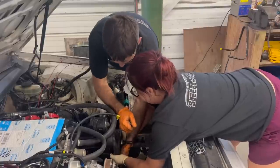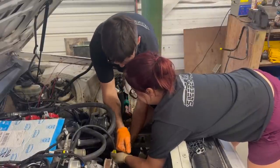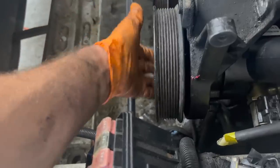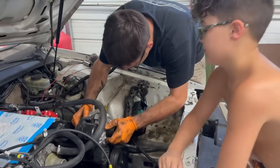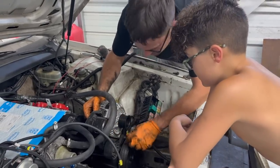We're having trouble with the pulley moving on us. We finally got that on. Here's the real test. Oh, it was the pulley. Okay, we're gonna have to be looking for a pulley, and we probably bought a pump for nothing, as I don't remember this one whining before. So I'm gonna have to get a Super Coupe specific power steering pump pulley somewhere. They thought at the parts store that I was getting this for a diesel truck or something, because it was 8 rib. I'm like, no, just got a hog leg in it.